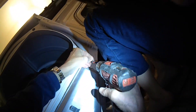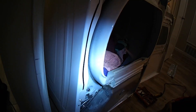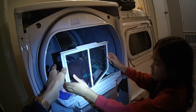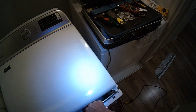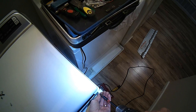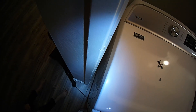Now I'm putting the power supply leads onto the element — wiggle that on, wiggle that one on. I'll get the guard back up and push it back to keep the heat in tight. We've got all our connectors on, the thermal fuse on, and the connectors on the high limit, which is right here. This high limit often blows too, so it's a good one to check.